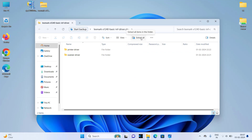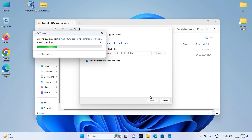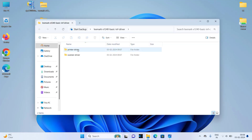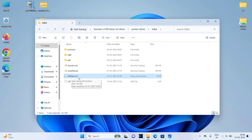Click on Extract All, then click on Extract. A folder will be created on the desktop or in the same folder where your driver file is located. Double click on the folder and double click on the printer drivers. The file you need to install with is called lxczprc.inf.